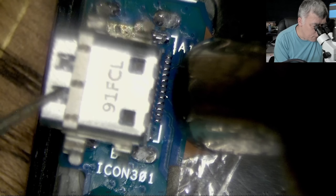The port goes nicely inside. Now we can use some flux, just to make sure the pins are soldered properly. I'm not taking the board out because the case is a metal case — the case of the laptop cannot get melted. Each pin is soldered.